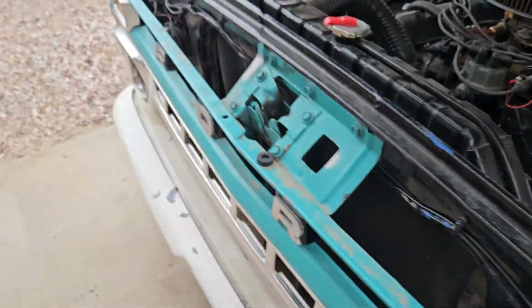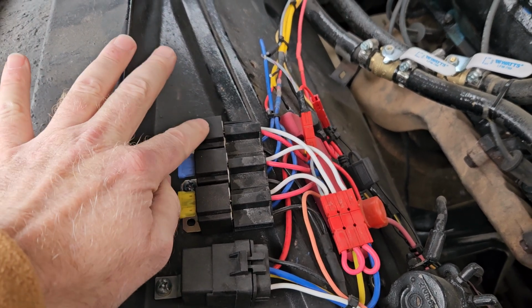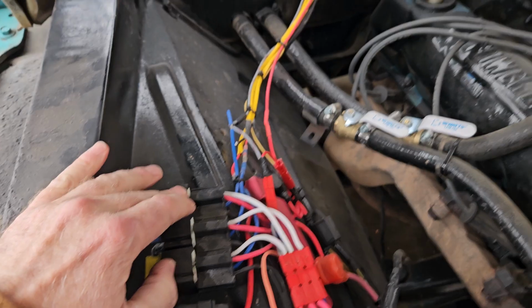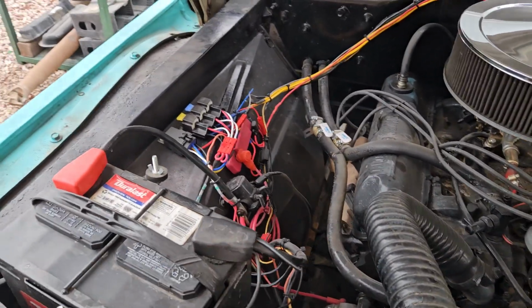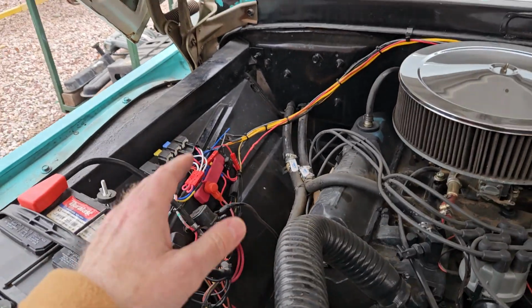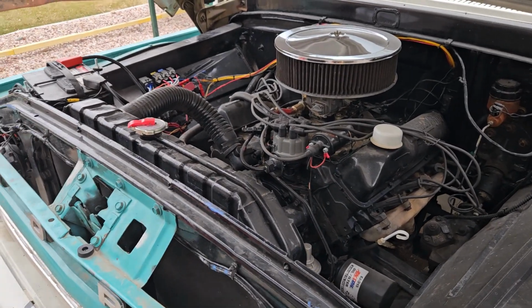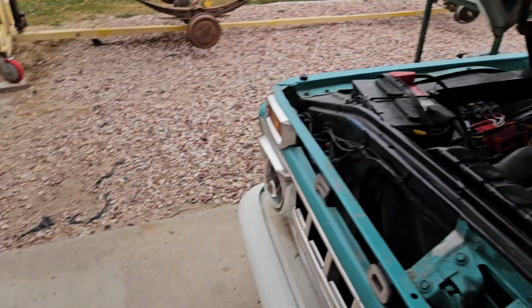And of course, that's the other reason why I want to do it right here, right now. I don't have the fuse in it, but I will put a fuse in it, and so I can fuse it to whatever I think it will use as far as power. I got an ammeter I can put on there and actually see what kind of current that thing's drawing, and I might do that. But the point is, this will be the fastest way to do this and get it done today. So that's probably what I'm going to do.